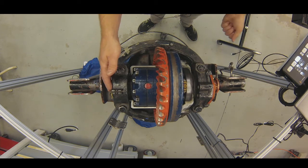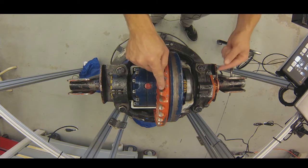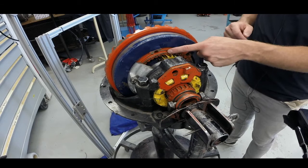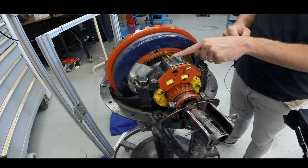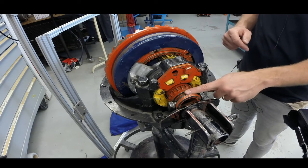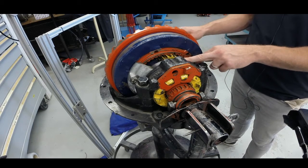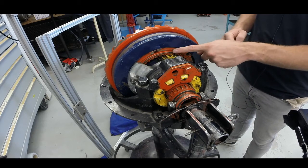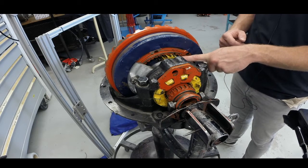Our components then: the pinion below driving the bevel gear, the bevel gear driving the internal right here. The internal driving in our low speed would be driving these pinions. The pinions are rolling around the internal and rolling around the Sun gear, and our carrier is the output. So we're in on the internal, we are out on the carrier — in on the medium sized gear, out on the large. This is how we're getting a reduction in first.